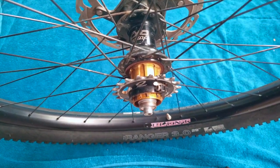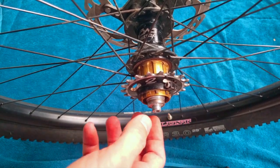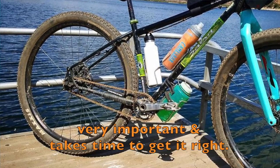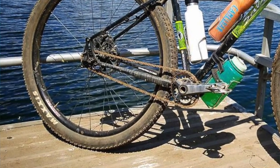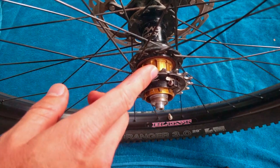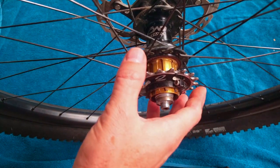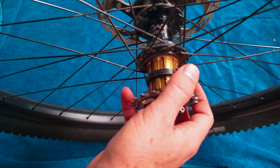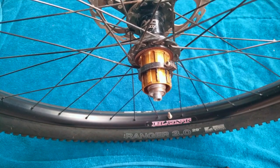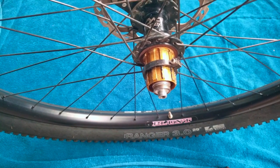But what you really need to be efficient with that process — it could be a very fast and efficient bikepacking setup — I'd recommend that you bring an extra chain so that you don't have to re-tension your system. Whether you're using an eccentric bottom bracket, sliding dropouts, or a rocker dropout style like I have on the El Mariachi, you're going to be tensioning the same chain with a cog that has an additional tooth or two, and it's going to be significantly longer if you don't have that extra chain that's the appropriate length for the front chainring and the rear cog. So I learned that for doing that fast setup, it'd be nice to have two chains as well as two cogs so you can get going again quickly without having to adjust everything.